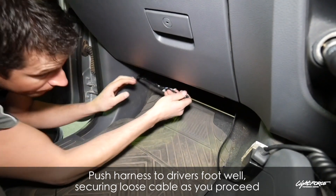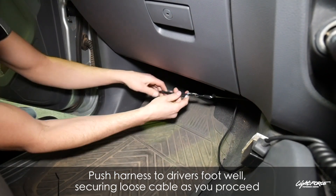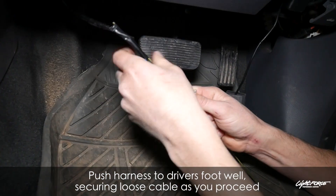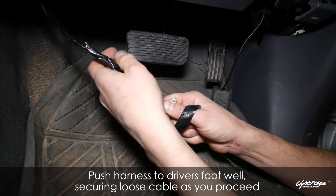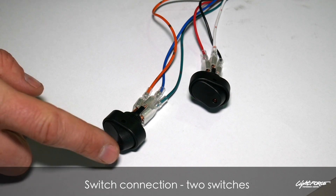Pull it through on the left-hand side underneath the glove box. Make sure to give yourself plenty of slack, and on the Ranger, above the transmission tunnel there's plenty of room to trace it straight back through into the driver's side footwell. Then take the tape off the terminals and discard the piece of wire.